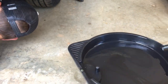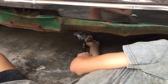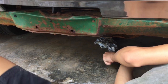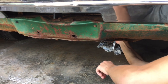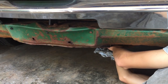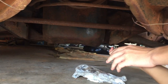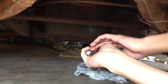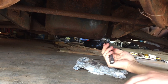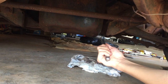Get that oil out and just sit that rag under where it drips from. Get that ratchet on there and just tighten that up - but you don't over-tighten oil plugs, you just sort of snug it up and then give it a tiny little bit more. That should be good. I didn't hear you ratchet at all - just give it just a touch more. That's it. Good.